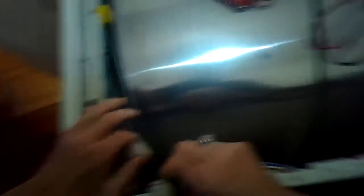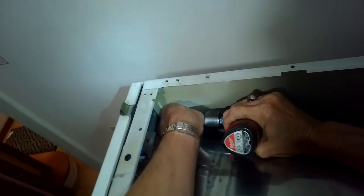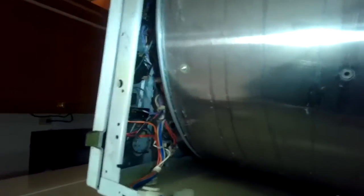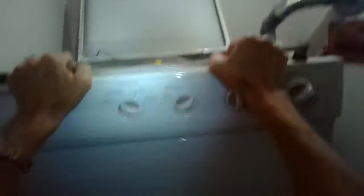I'm going to remove this modular connector that brings power to the front of the dryer, and I'm going to remove the front panel. There are a couple of Phillips head screws about six inches down on the left side and on the right side. Once I get those screws out I can grab the top of the front panel, pull it toward me, and it will release a couple of clips. I lift it off two little clips at the bottom. Now I have access to all the important parts inside the dryer.